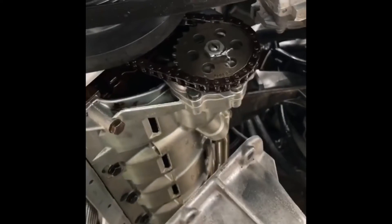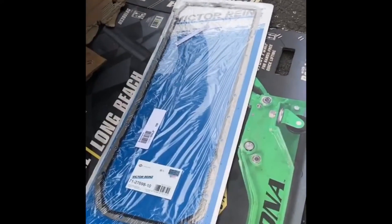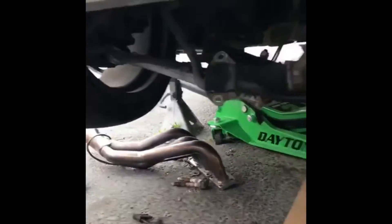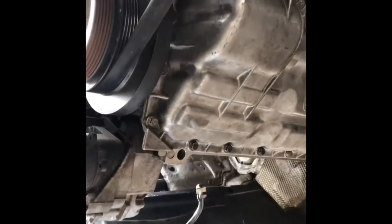Got that installed up there with the wire so it doesn't back off. We've got a supercharger going on, putting the exhaust manifolds back on today. We're finally gonna get the oil pan gasket back on, get the oil pan on, and maybe start putting the subframe back together to close the bottom end off. The oil pan is in, all the screws are in and tightened up. We've got to tighten up the power steering pump, a couple screws there, then we're gonna put on the headers.